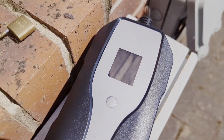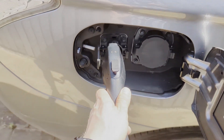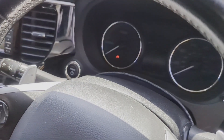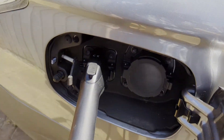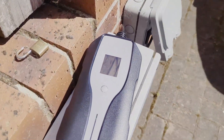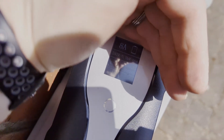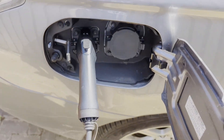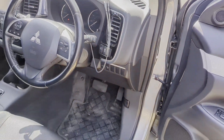Outside — you probably can't see it, it's not bright enough — but it is set to six amps. If I plug in the car... I heard the relays click, and there you can see in the bottom left-hand dash it is in fact charging. I wonder if it will charge at eight amps. To find that out I need to disconnect, press the button — now eight amps. The car seems to be charging. Excellent, that seems like a success.